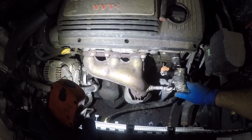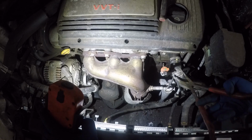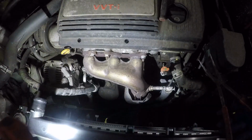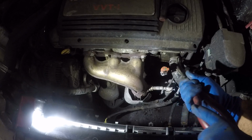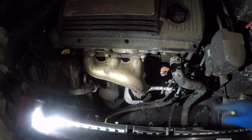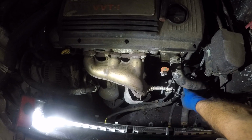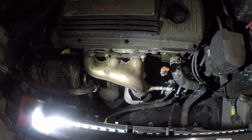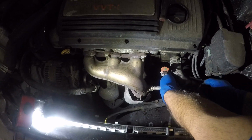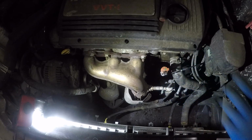Alright guys, next I'll take the upper radiator, lower radiator hose that goes right here. I'll put that in. I'll take my needle nose, squeeze up that clamp, but this light is always a trouble for me. Squeeze up that clamp, try to get it in the same spot we had it, guys. There we have it. All this is tight. Make sure you lock up these little guys right here, the vacuum lines. Alright, and I'll put a small zip tie here in a little bit. Let me get it right now, guys. Zip tie goes right there. That's going to protect the little line here, the cable for the oxygen sensor. Don't squeeze the hose. We'll cut that off in a little bit.